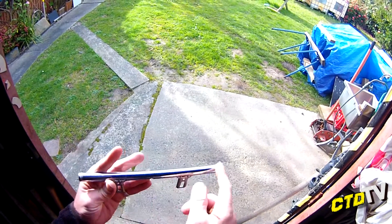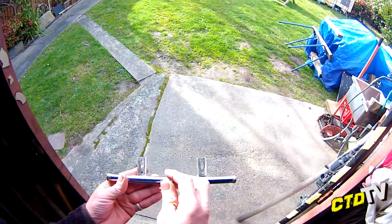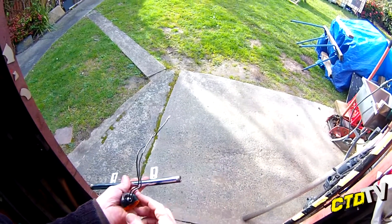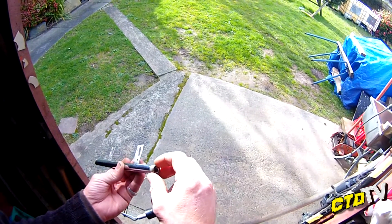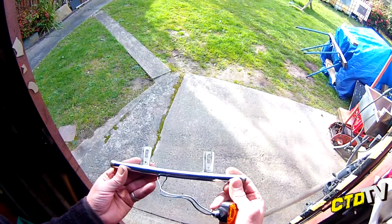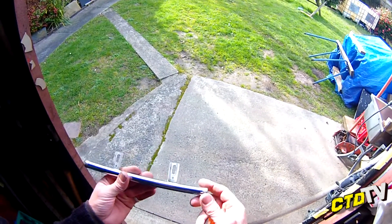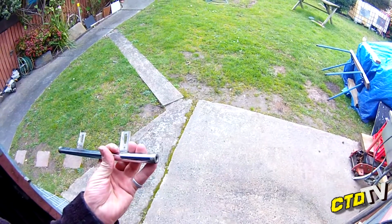I'll just make a new one, maybe not out of chrome — I don't have much chrome left, if any. I'll just use a piece of steel so you can paint it. Put the tags in the right spot, same spot as my Z. Whether or not you wanted to use them as an indicator one, it'll be the right thread down the track. Or you could use a bolt and just bolt that in there, put the wiring elsewhere, bolt the bracket of the spotlight. Yeah, one of the two points or whichever — because some of them have two points, some have a single point bolt-on bit. But you could bolt it straight in the ends. Yeah, so you could use your bolt in the end to bolt the spotlight bracket on. Something like this, perhaps.